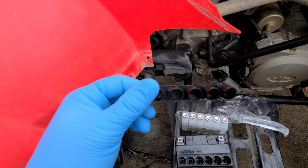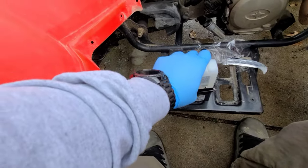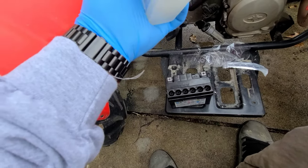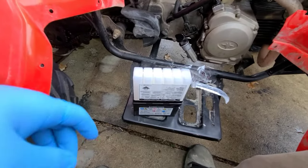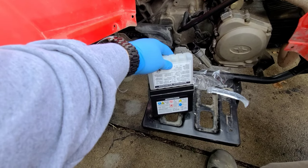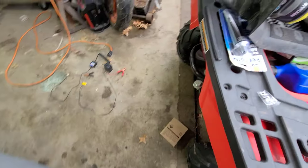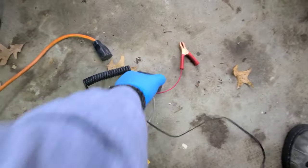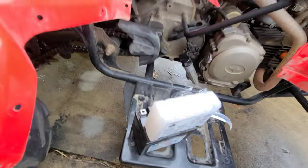Okay, so you got it open, you got that part off. Oh no, it's still sealed. You just push it down there and those will actually break. It takes a little bit of force, but it will actually break and slowly drain into the battery. And then this actually goes back on the battery itself and I just have one of these little Harbor Freight chargers — I just plug it in and charge it with that. They work good, charges them slow, but as you can tell it drains in there super slow.